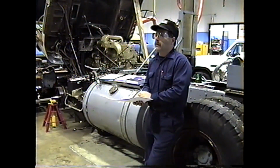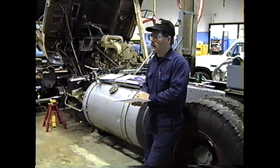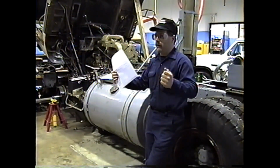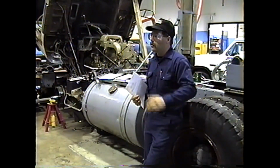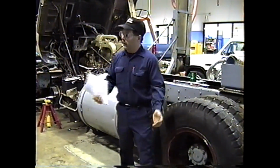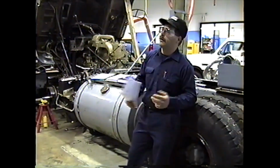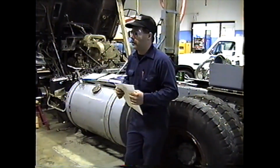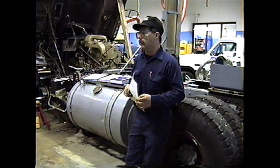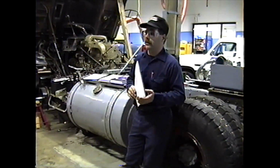If you remember, most manufacturers, when they want wheel bearings set up, they don't want the wheels on, and the excess weight on them can throw you off your adjustment. So for the rear cast spoke wheels, you would have to remove them and then check your wheel bearing adjustment and then reinstall them. There's a procedure on how to do it safely and correctly, not only so it's safe to you, but so it's safe to the driver.